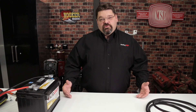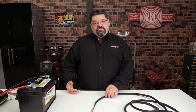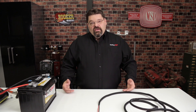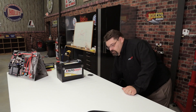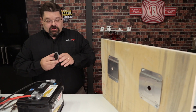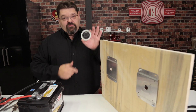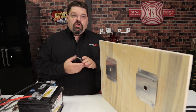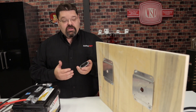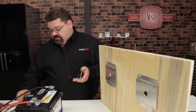There are a couple other installation options to discuss. We talked about mounting the ECU underneath the hood, but what about mounting it in the passenger compartment? Depending on where the battery is located, you will need to run your harness through a sheet metal firewall or bulkhead, and there are precautions to take. One option is Earls Seal-It grommets — a fire-retardant rubber center with an aluminum outer shell set up with four mounting holes, easily mounted into your firewall or any metallic bulkhead, available with different size holes as well as an unperforated option for custom applications.